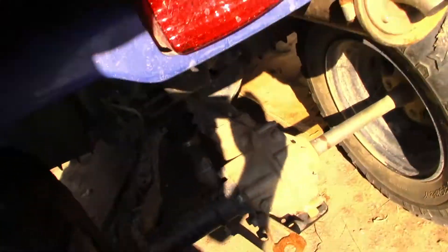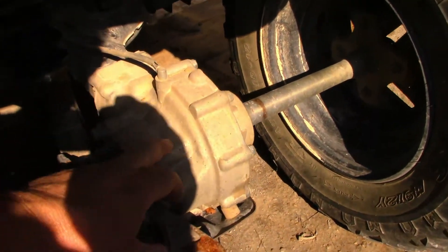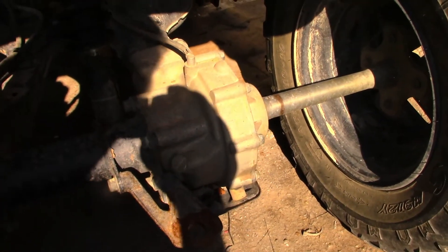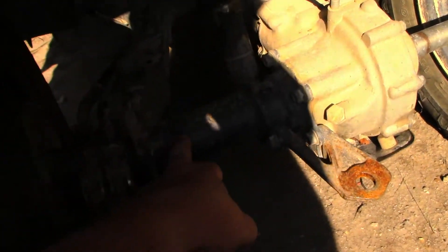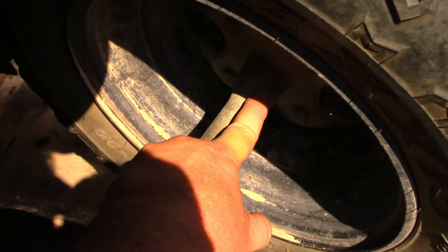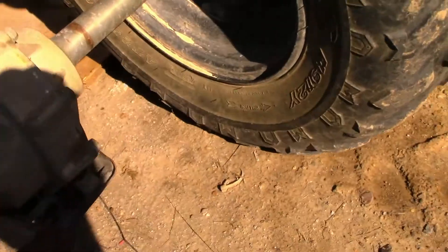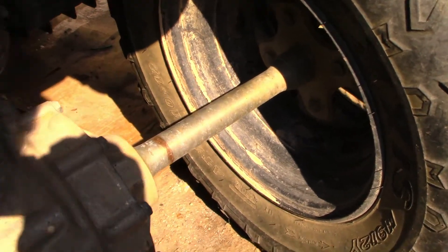This is shaft drive — most are shaft drive now, so you'll see this drive unit, same as I pointed out on the front of the Viking. Take a look at the axles in here. You want to make sure you don't have rust showing around the gap where the hub fits over the shaft — there's a spline on the shaft. If you see a lot of rust around there, or if you shake the machine side to side and you see play in that, it can mean you have bad hubs and/or a bad axle. That can be kind of expensive to replace.